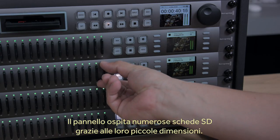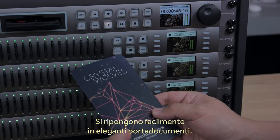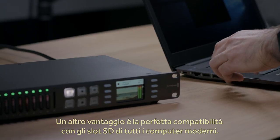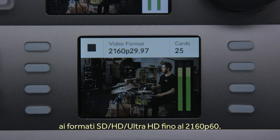The SD cards are very thin, so each duplicator can fit more of them across the front panel, plus they present well to customers in a printed wallet. SD cards are very compatible as virtually all modern computers have SD card storage slots built in. The SDI connections on the Blackmagic Duplicator are the latest 12G SDI that auto-switch all SD, HD, and Ultra HD formats up to the high frame rate 2160p60.